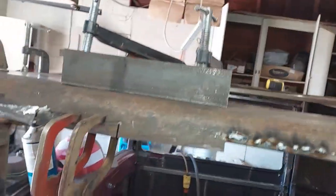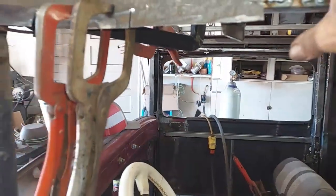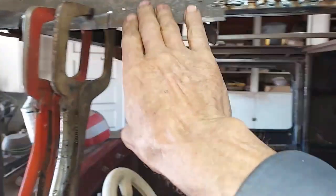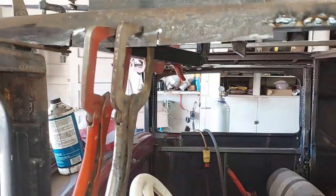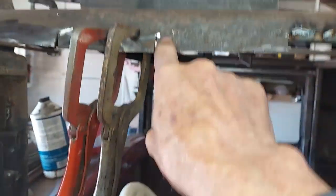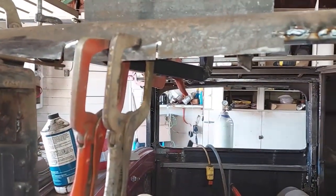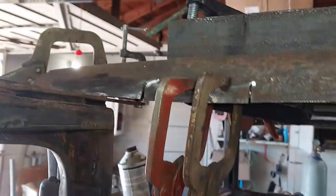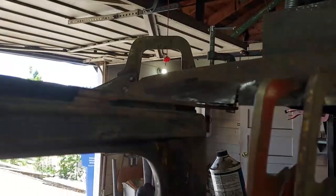I just keep going about eight inches at a time. Bracing it up there — not that this roof is going to stay on that bar, but it gives me the same pressure when I bend it over all the way along. So I've got this bent down now. I'll mark it and cut it across here, then clamp it and weld it all the way to the end of that angle iron. Then I'll do that last front piece.